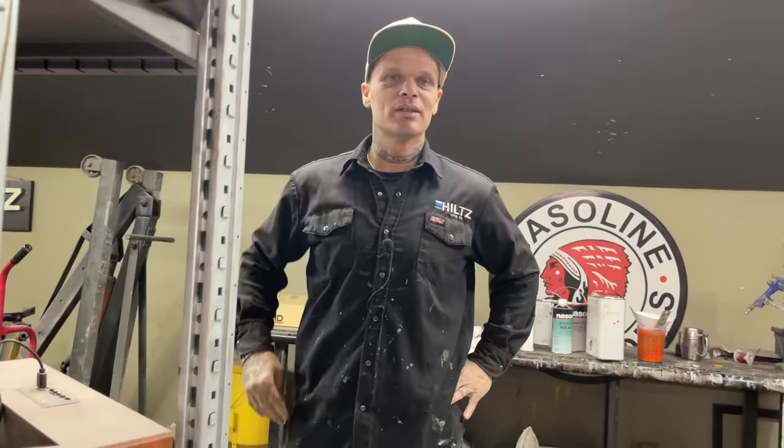I still gotta take that off and weld up the seams in that. And the reason I wanna weld up the seams in it, I thought about it myself: if I don't weld up the seams, then they gotta take the bumper apart, and that means they're gonna have three pieces to chrome instead of one. So if I make it a one-piece bumper, it's done. The way it is now, they'll take that bottom piece off, chrome it, take the other piece on the other side and chrome it, and the bumper. So that means I'd have three pieces. It means more work, obviously.